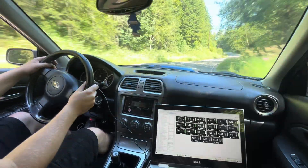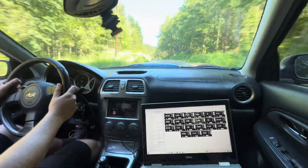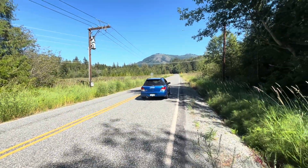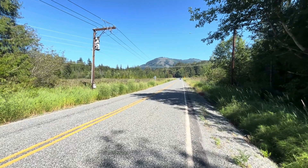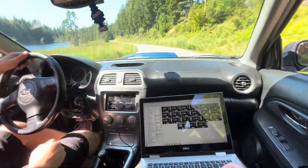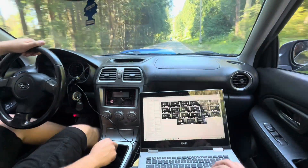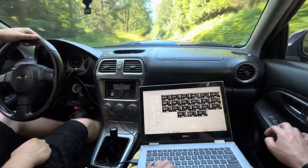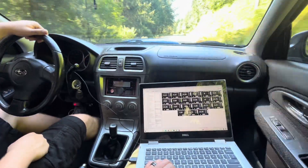I feel like it's making so much better noises now too. Yeah, the bigger turbo makes better noises for sure. That's the first time I've missed a gear in this thing — the suspense! There's quite a bit of adjustment going on so it'll feel smoother. There's some knock — I don't know at what point — but I'll review the tune and we'll smooth that out. It's not a crazy amount but it's worth looking at.